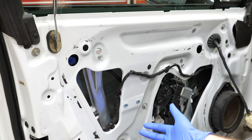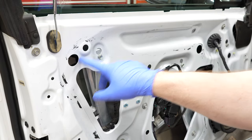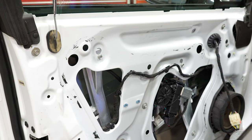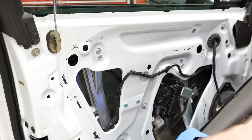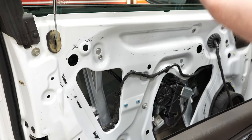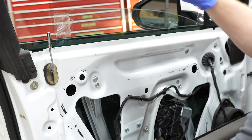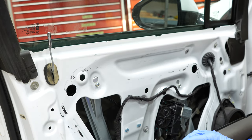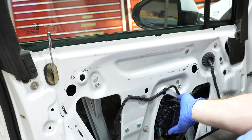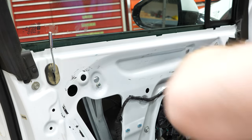The reason that's a little scary is the window bolts aren't tightened yet, but it's not that bad. Hold the top of the window down into the rubber holders as it's going. Turn the car on — it bongs at you insistently — hand on top of the glass, go down: one, two, three; come up: one, two, three; let off the switch, and it should have learned the up and down positions inside the regulator motor itself. Then just unplug the door panel again.